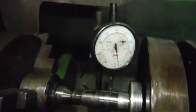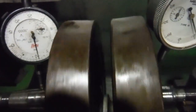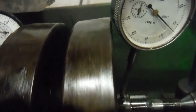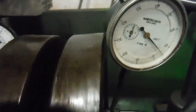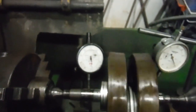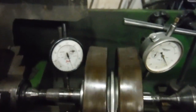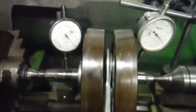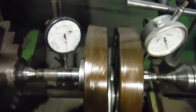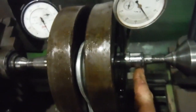As it came out of the engine, we've got quite a bit of run-out. There's about six thousandths of an inch showing on that clock, and certainly a good five — possibly even six — thousandths of an inch on that one. The needles are rising and falling together, so one actually cancels the other out, and this crank would have probably spun quite smoothly inside the main bearings, had they been in reasonable order. But they were in a terrible condition.